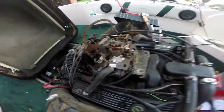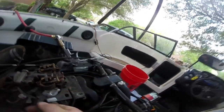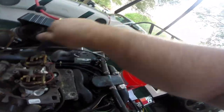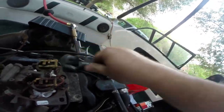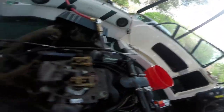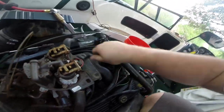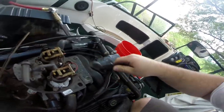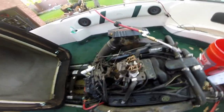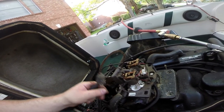Next step is to clean off this throttle body a little bit. Take a wire brush — I stuffed some rags down in there — and we're going to blow all this rust and gunk out with compressed air. Especially with plastic parts, you want to be real gentle, but with metal stuff you can really dig in. We already kind of cleaned off that plate as well. Engines should be clean — you can see how much cleaner all this is where we rebuilt everything. Next, we're going to put our new air cleaning unit on.